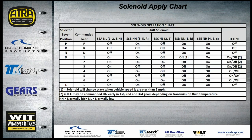On the solenoid apply chart, in drive first gear, the SSD solenoid for first and reverse is off. At approximately 5 mph — shown with a number 1 in parentheses — the solenoid changes state when the low reverse clutch is dropped. At that point the sprag must hold or there will be definite neutraling or flaring into the next shift. Also shown with a number 2 in parentheses: the TCC can command the converter clutch on early in first, second, and third gear, depending on fluid temperature.